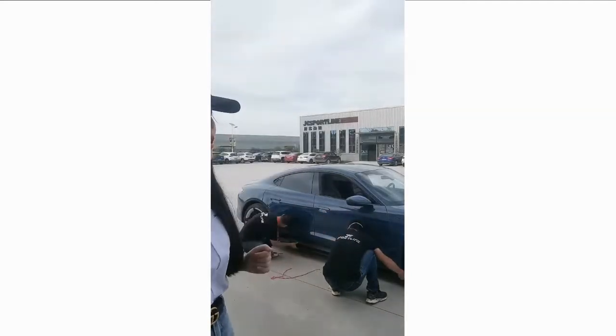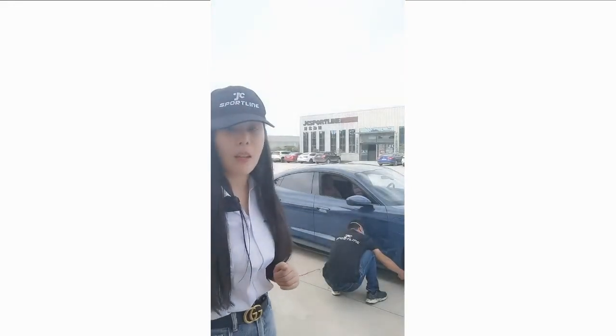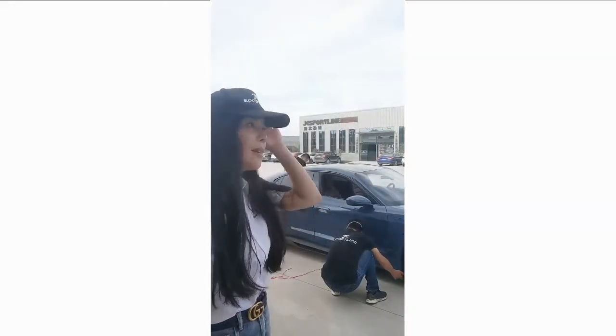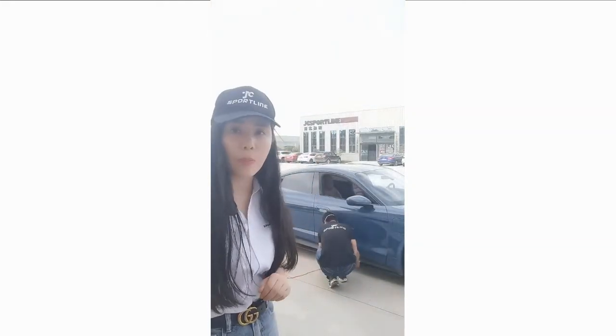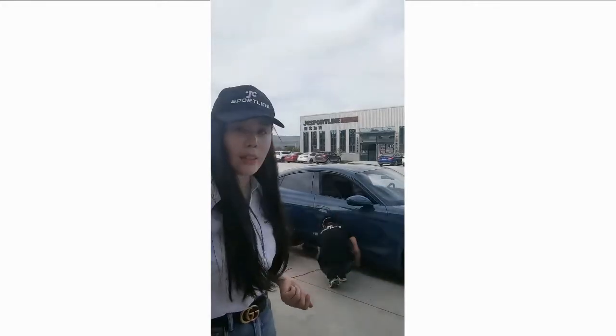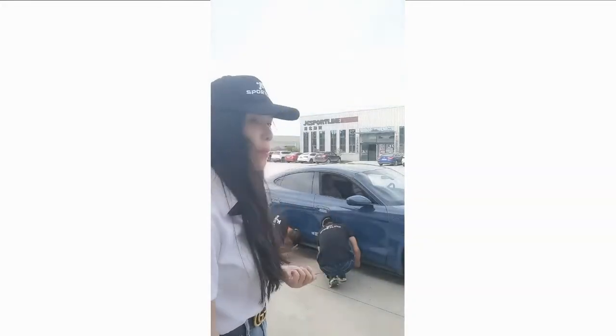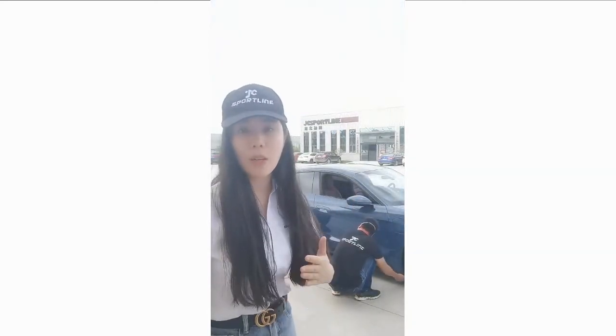And I just told you that there are a lot of painful points for the installation of the carbon parts, because in recent years a lot of suppliers just copy from the sample, and they can't make sure that the sample does not deform. So if we use high technical skills to make the mold, such as scanning the car to get the real data, then using the CNC machine to make the mold, and then using the autoclave for the production, we can guarantee the full process to make sure of good fitment.